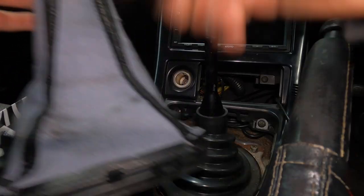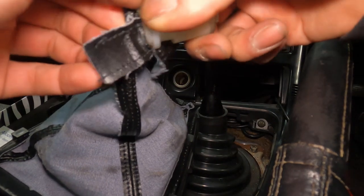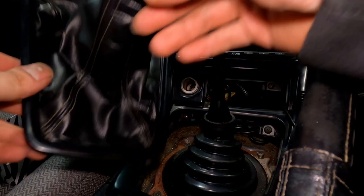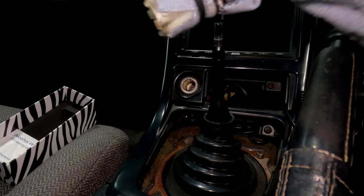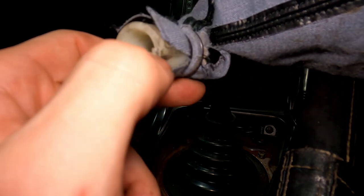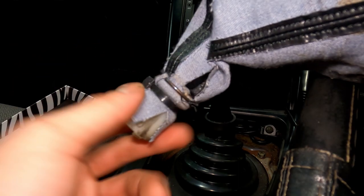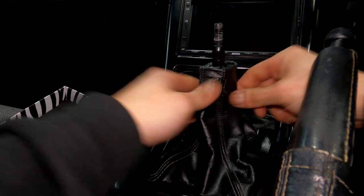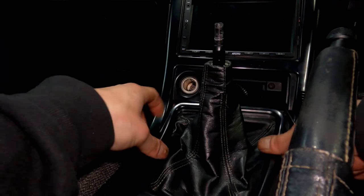Since the shift boot retainer didn't work, I need to put the stock retainer and clip back in, then we can keep going. Well, I actually broke something — there was a little plastic ring on the lower collar piece for the shift boot retainer. I snapped it; it's just old rubber that didn't hold up over time. But a zip tie works fine and I still have the metal ring in the top for alignment, so everything should work out. Throwing the boot back on and sliding it from the back down.